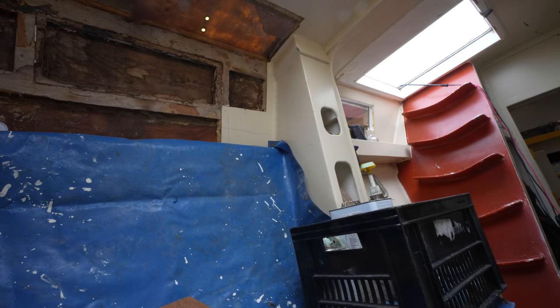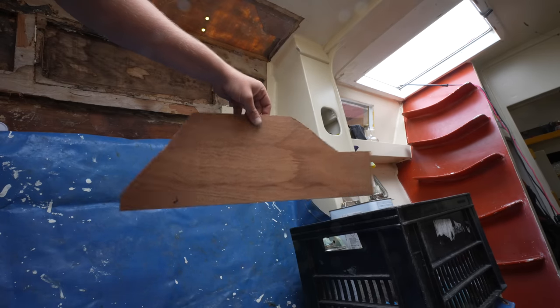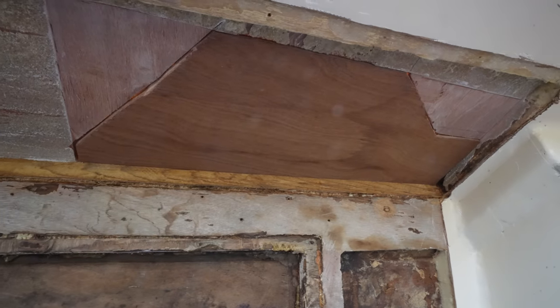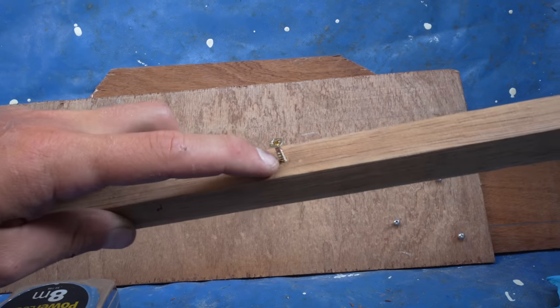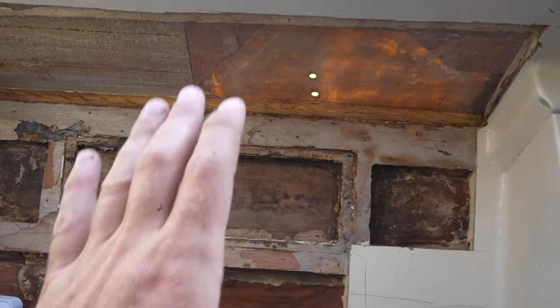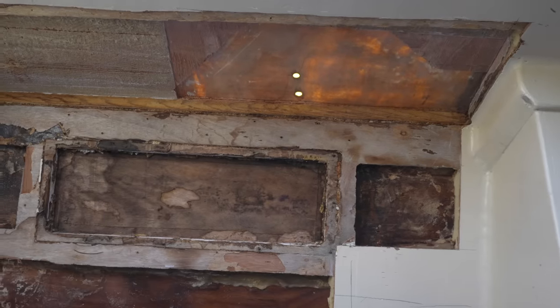Prepared, everything up here is sorted. A little piece looks like an old Renault 5, is it? There's a bar I'm gonna screw in. Oh yeah, got the screws ready. I'll take those out after, these ones, especially because they're not stainless steel. Yeah, I'm gonna acetone everything, degrease, pre-coat, filler in the top, put the piece in, put the bar in, put the backing pad, screw that all in. Should be solid enough.